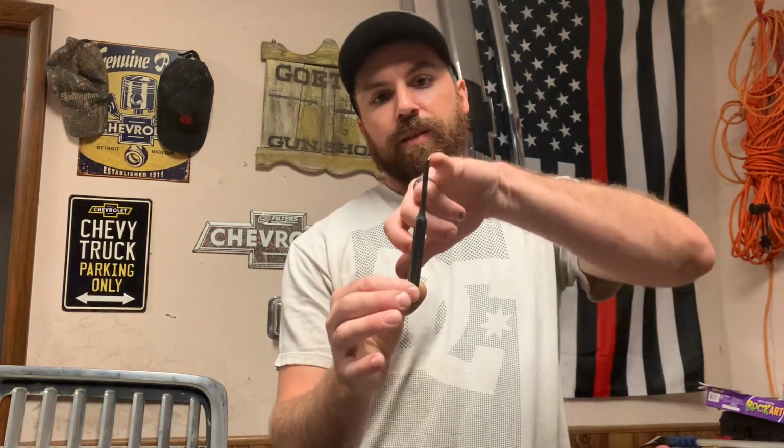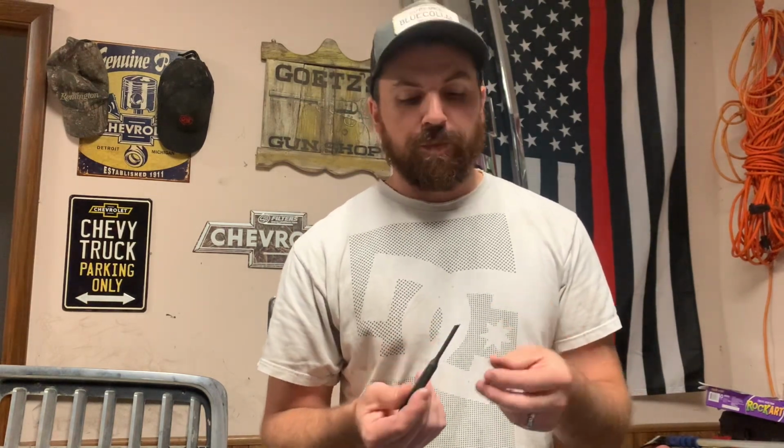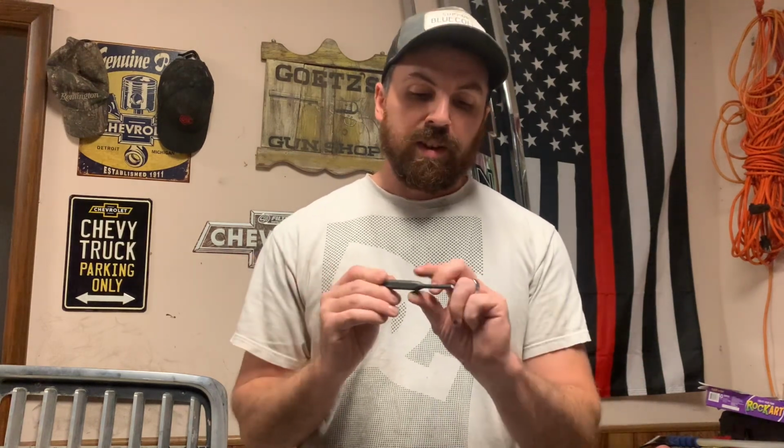If you got a set of punches and chisels, I always got a couple where I grind an angle in there. You can use this chisel. This is a little smaller one to use on any of the bushings and stuff, but like if you're doing a clutch on a 10 speed or something and you can't get the cross shaft bushings out if you got to replace them, this works really good. Or like kingpin bushings, I've used a punch with the bevel kind of ground in there.